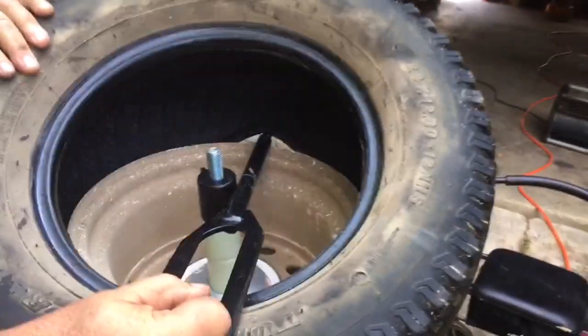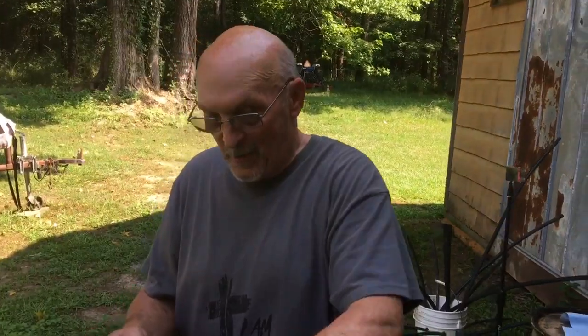Then you just repeat the process and go down and get that bottom side. When it comes to these valve stems, I'm going to leave that valve stem in there and put that valve core back — it'll save you a little money. True, you stand a chance it may pop out next week or something, but you stand that chance with a brand new one. There ain't nothing wrong with that valve stem if it ain't been leaking. Just put your core back in there and use the thing again and save yourself another four or five six bucks.